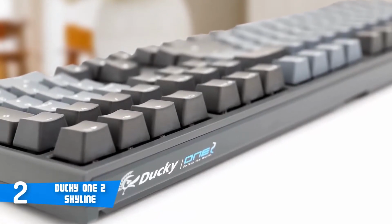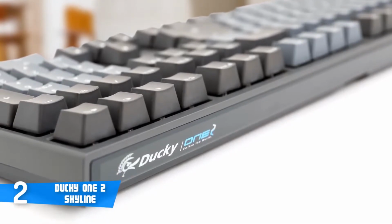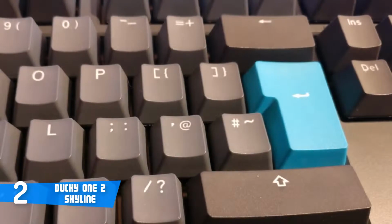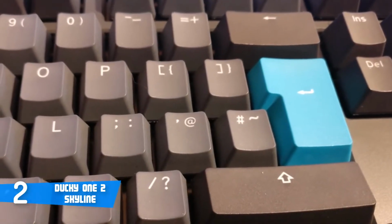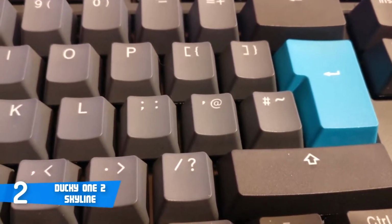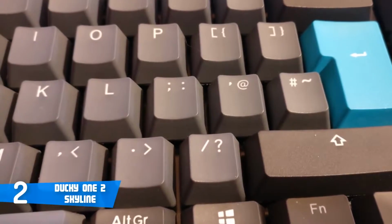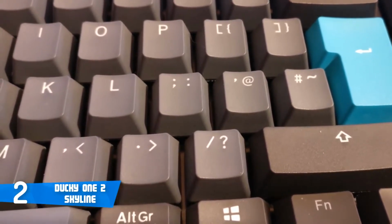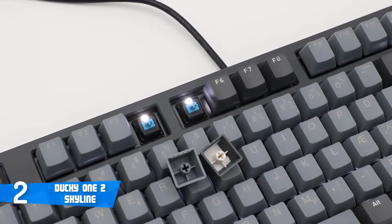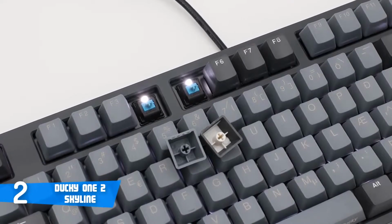Thanks to USB N-key rollover, multiple buttons can be pressed simultaneously without resulting in other problems. Furthermore, the 1000 Hz polling rate also helps avoid any performance issues, and this is paired with a modern USB Type-C connector on the keyboard end of the cable. This makes sure that the keyboard is successfully sending data to the PC every millisecond. In order to fit the ergonomic needs of individual users, this unit provides 3 positions, namely folded in, as well as half and fully extended.